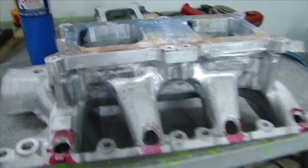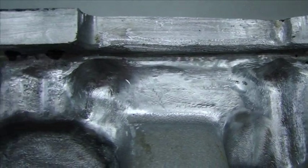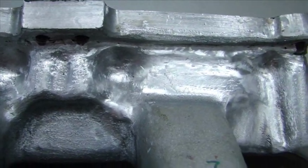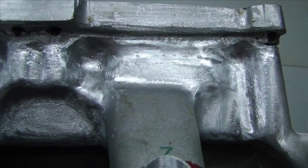Here is the start of the welding. I have one side just welded and sort of blended. You can see how the weld blends right in — I am trying to make this look like it is all one piece and I think I am going to get there. Anyone who does aluminum welding knows it takes an immense amount of heat, so keeping this from warping while getting that shape is very, very difficult. But I am getting there.